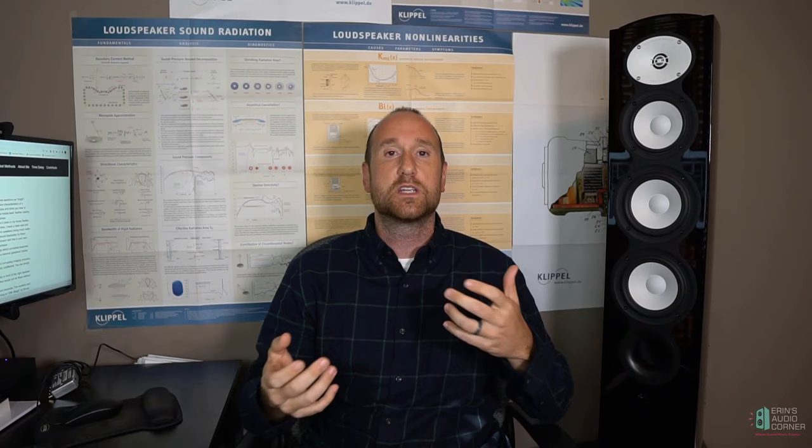And here's my side topic, so allow me to go off topic for a second. When I listen to speakers, a lot of times I'm having to turn them up to 90 dB just to get that kick drum or get that attack or get something out of it, something that evokes a visceral image for me. And again, I don't want to equate dynamics to loudness, but unfortunately, that's kind of just the way it goes because we're so used to hearing low sensitivity speakers that we feel like we have to crank it up to get dynamics. That's not the case.